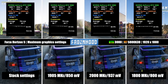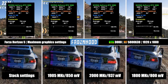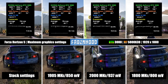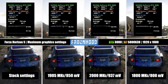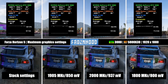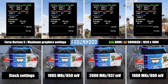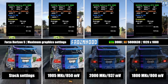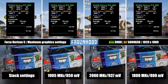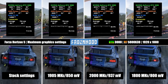Now let me show you some results. In Forza Horizon 5, with the default settings and no undervolting, the power consumption is around 310 watts, the average FPS is around 98, and the temperature goes up to 77 degrees. The clock speed is almost stable at 1905 MHz. I should mention that I am using the silent BIOS of my GPU. With undervolting at the same performance, both power consumption and temperature drop significantly — the power draws around 230 watts, which is lower than the power consumption of the 5070 Ti and 5080 in this game with their default settings. All these settings have been stress tested for days and are completely stable.